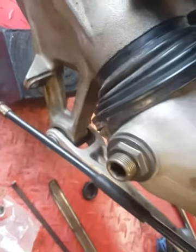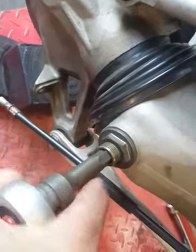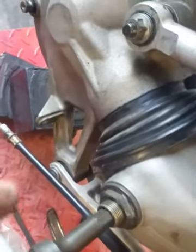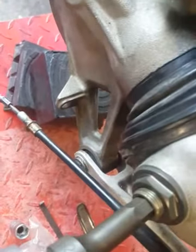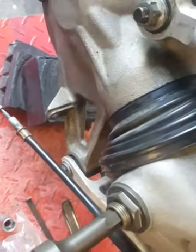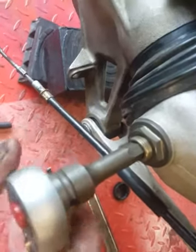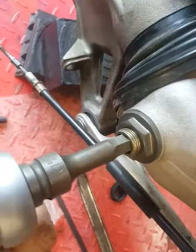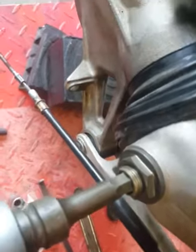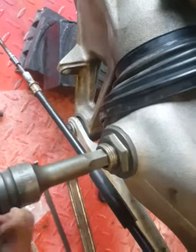Now I'm going to try and do this on camera, I hope. So let's just try. What I'm doing is quietly, gently taking up the end play in this little bush here. It's got no grease in it. It nearly goes all the way into that lock nut, so I know now, it's just happened then. So now this will still move very, very slightly sideways. I would much rather do this with a 3/8 drive spanner, but I haven't got an adapter. So that's just kissed the end of the bearing run now, just like there. And you just want to have it nip, just touch it, and then the very slightest turn.